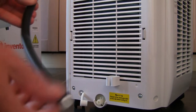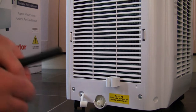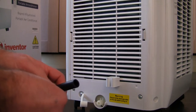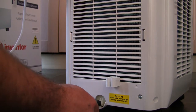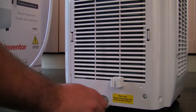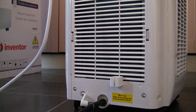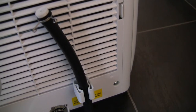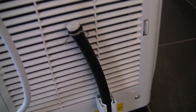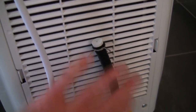You can see one end is blocked off already — it actually has this pipe connector here. What we'll do first is slide the new one on, which comes in the packet with the screw. Just slide that on there, move it down, pop this one on a little bit and push it on here. Make sure it's right to the back so you're not going to get any leaks — nice and snug on there. Slide this connector up, make sure it's all tight, and tuck this drainage hose into this connector here, making sure it's pointing correctly so it won't drag down and cause any unnecessary spillage on the floor. All clipped up nice and tight.